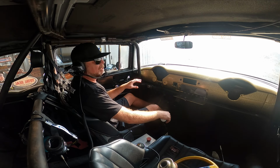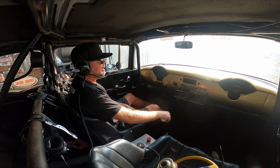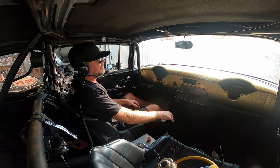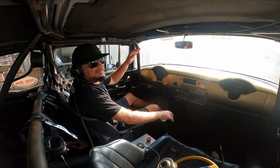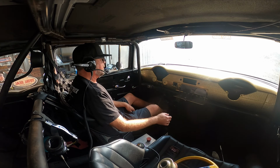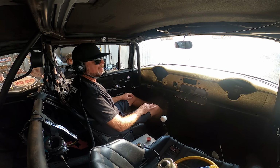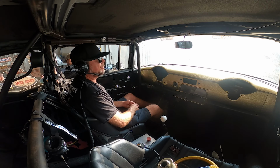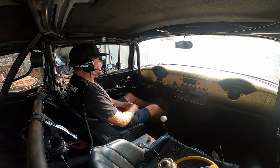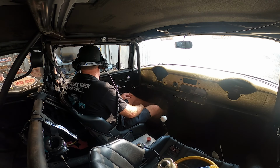And if I start the pull around 150, 155, it'll end at about 170. And that should mimic the conditions we had yesterday, other than the fact that the ambient temp is a little lower right now. But if there's any significant change with the air filter, I won't completely attribute it to the air filter, but there's something there, I think, good or bad. Pete's looking at data.